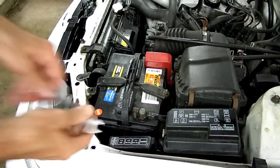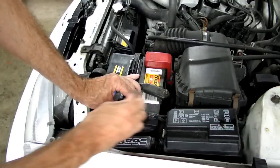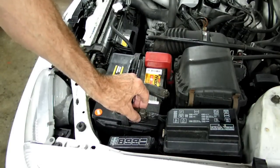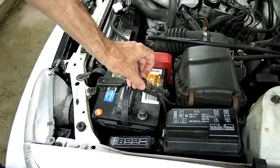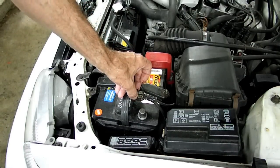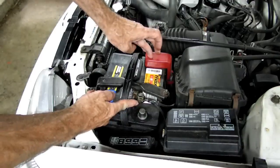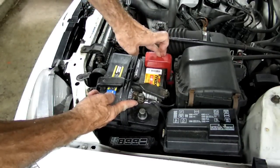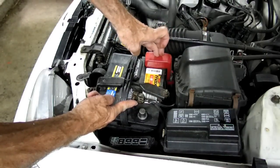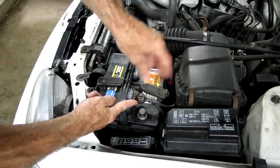On this vehicle, we're going to take off the negative battery post. That will wipe out any memory in the computer if we don't have a memory saver. This is just a demonstration to make sure that it works. Now if you are changing the battery, remember: when you take that positive cable off, that's live. So protect that cable. Do not let that positive cable touch any ground, because you've got voltage from that memory saver.